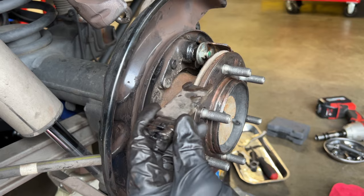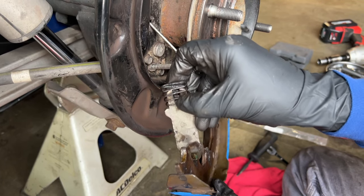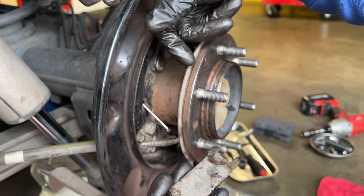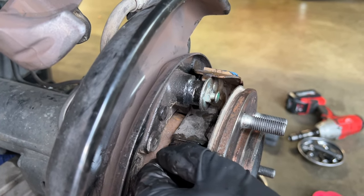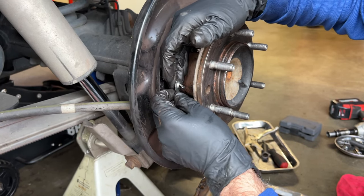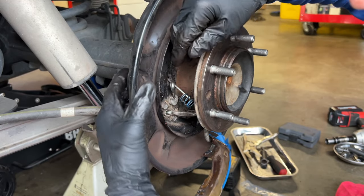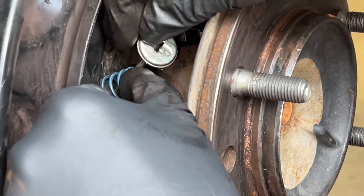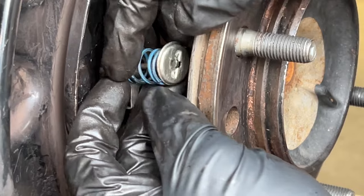The spring is hooked. I hook it into the front shoe and let it hang. Now I get this part into position at the top — it's a mirror image of the other one. It slides into this part of the shoe in this orientation, with the nub and the longer side facing the axle flange. I slide it in and get it started in the slot on that shoe and let it rest there. Then I preassemble the hold-down spring assembly on this side: I slide the hook plate on first, then the spring — it helps to put your finger on the backside to hold it, or use the magnet trick from part one — then lock it in place by sliding it in and turning it 90 degrees.